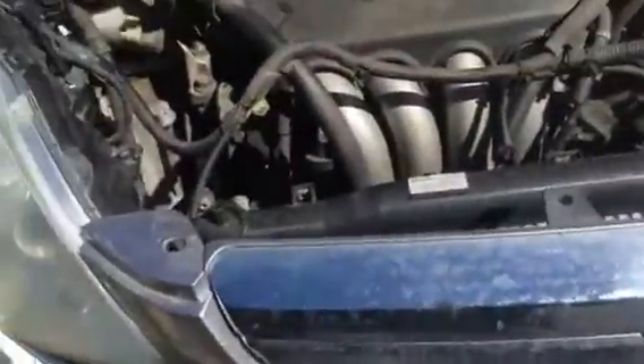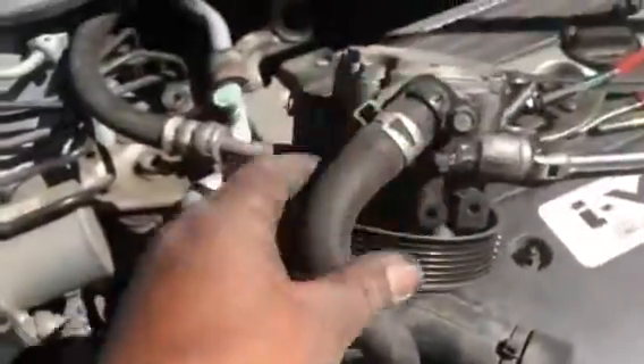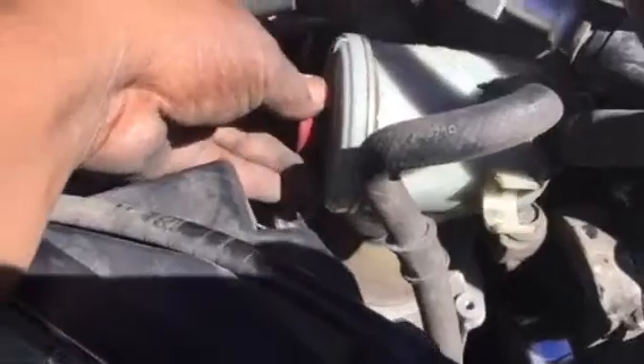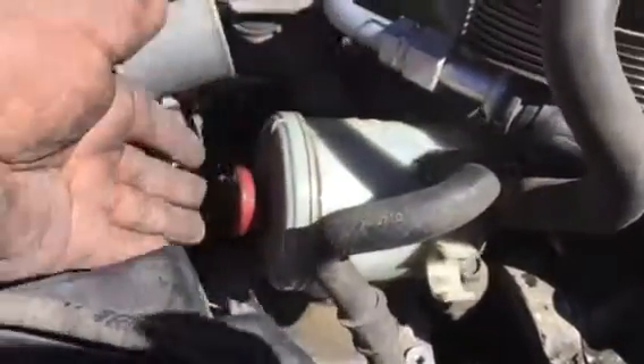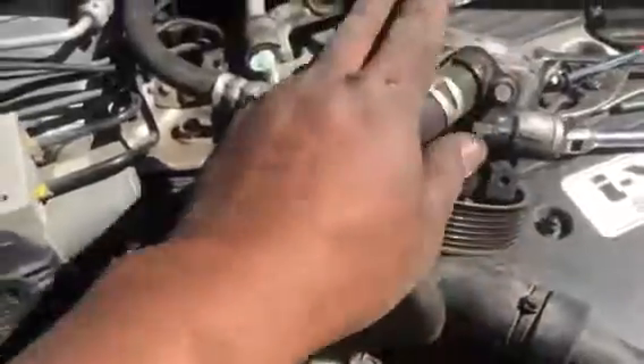I hope this video helped you. If you have questions, just type us at B-Tire Plus and we can help you. We don't even disconnect the power steering, so you can see the fluid is still inside — no drips, nothing. You won't make a mess. The only thing you have to make sure is to remove this bolt right here from the AC high-pressure hose, so you can just move it a little if you need to. You can put the pump on top so you don't disconnect anything. Thank you for watching.